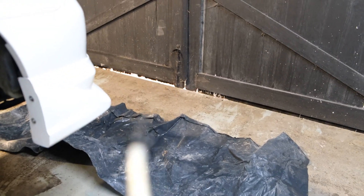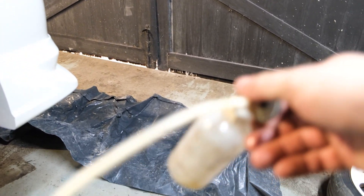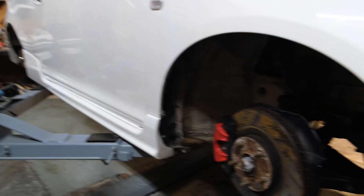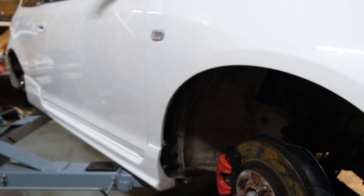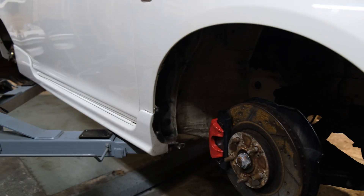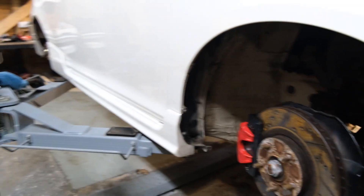So obviously I just want to bleed the brakes. Get one of these bleeding kits, put that end onto the bleed nipple, and then start from the furthest point from the ABS — so that'll be the other side, then that, then the other side, then this side. Just keep depressing it with the cap off, keep topping up the fluid, don't let it go below the minimum, tighten it up on each one, and then you should be good to go.